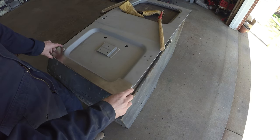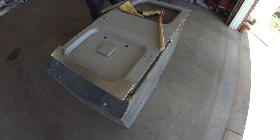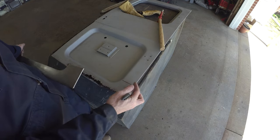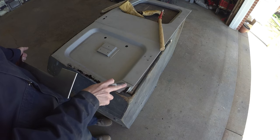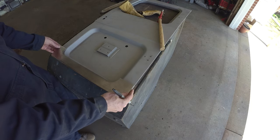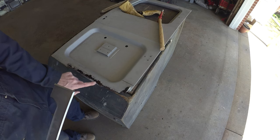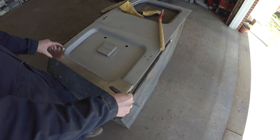But it gives us a little bit of a reference point if I snag the old markeroo. Hey, it's still got a cap. It at least gives us a rough idea of where we can go to. It's nice to save as much as you can, but realistically we're going to probably use that whole patch panel on this side. This other side we may keep it a little bit lower. Depends what we need to work with behind. It has this pinch seam, so depending on how far you got to go up for that inner panel, it's going to probably drive a little bit of how far up I decide to go on this side. We'll put a mark just for reference. It is helpful.